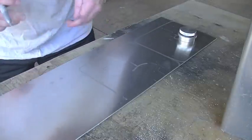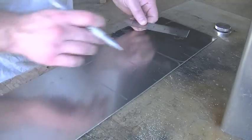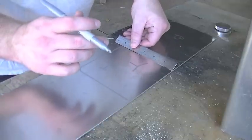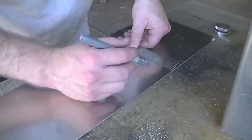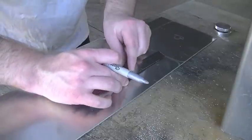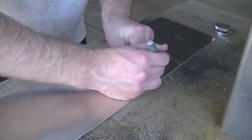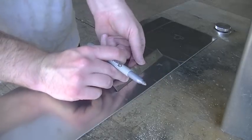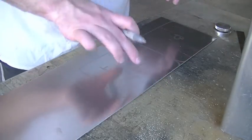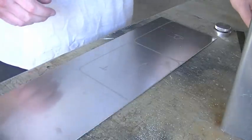Right there is where we're going to punch a hole. This hole over here is for the tube to go down into from the radiator. We're just going to give that some arbitrary numbers and we'll do the same thing — inch and a quarter from each edge — so there's just a little bit of symmetry there. We'll punch those holes out and then cut out both the top plate and the bottom plate, and then we'll get cracking on the bracket we need to fabricate.